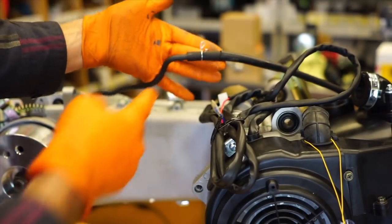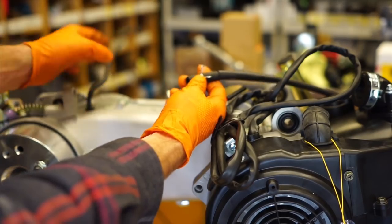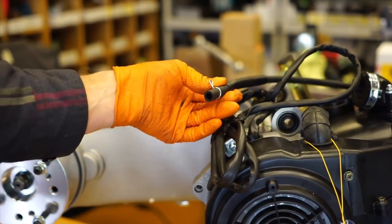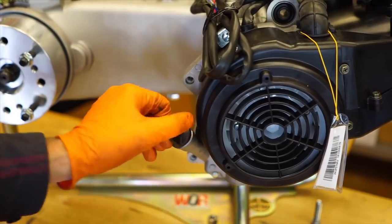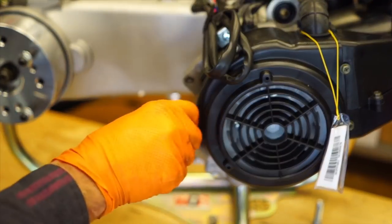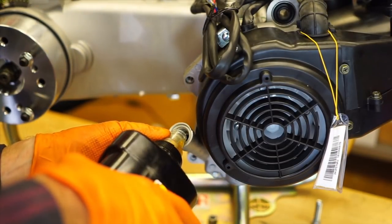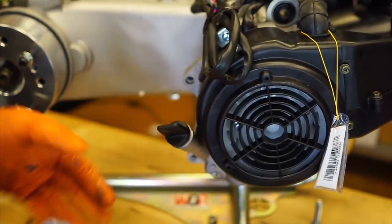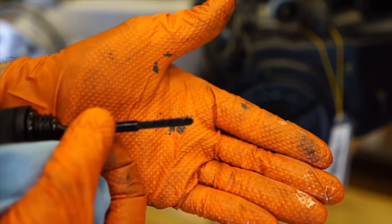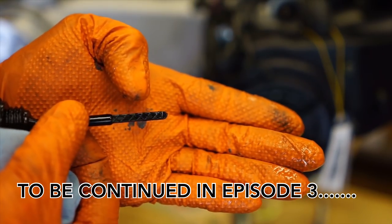On your motor, they get shipped with the gear oil breather and the crankcase breather for the gear case, and this is the head breather for the valve cover — they're put together like this. Don't keep them like that, otherwise you're going to have major problems. Before I put the motor in, I'm going to add oil — we can't forget to do that. This engine is perfectly straight up and down. I'm going to fill it up to the high point — there's a graded area. It's not touching at all on one side, but on this side it is. They need to be the same on both sides, so I need to add more oil.